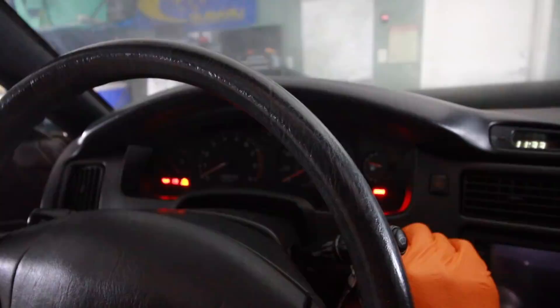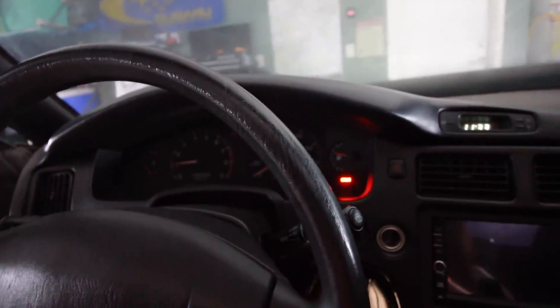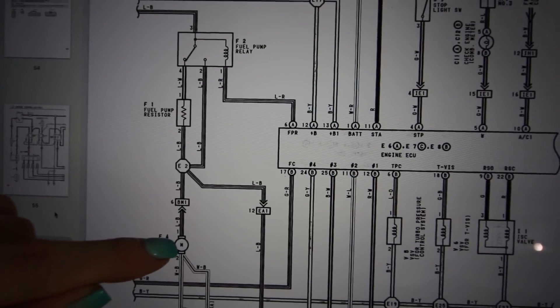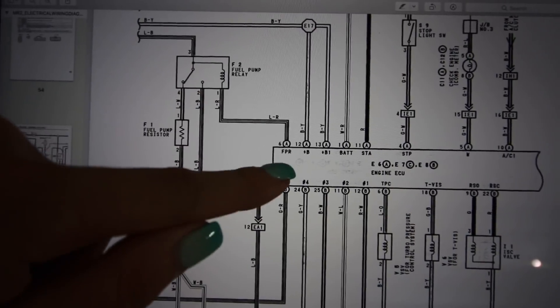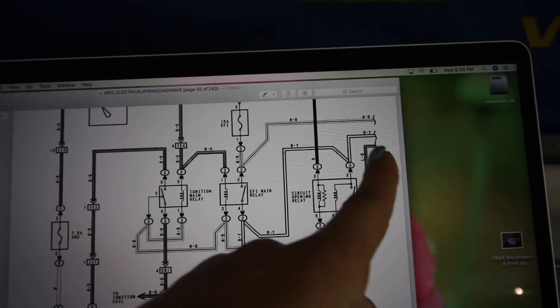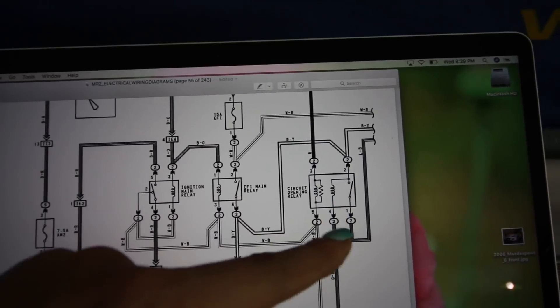Hold on to your tater tots. It'll die if I let off — it's idling, then it dies. To give you an idea of what's going on: here is the fuel pump. What we basically did was jump a power wire to this side of the fuel pump where you're supposed to have 12 volts in. The problem is none of this circuit has 12 volts like it's supposed to. However, there is power coming from the ECU into the fuel pump relay. In the circuit opening relay there's a set of contacts that need to close to allow the fuel pump to run.